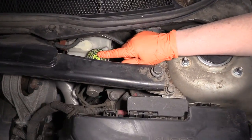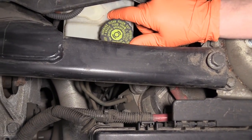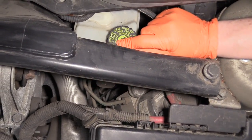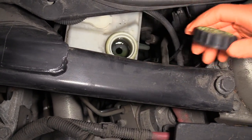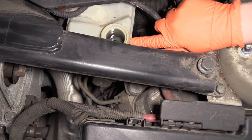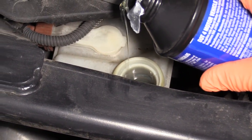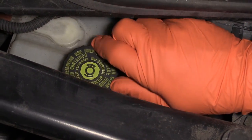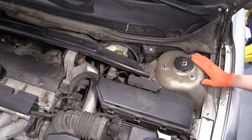After I've done the brakes, I'm going to check my reservoir and add brake fluid. The reservoir is located right here in front of the driver's seat in the engine compartment — the cap clearly says brake fluid and it tells you DOT 4 brake fluid; this is a European car. Take the cover off. I can see the markings on the side — there's a max and a min and I'm right at the minimum line. Now I'm just going to add some fluid and top it off. Now that the level's at the proper level, I'm going to reinstall my cap, pump my brakes, see how the pedal feels, and see if I need to do any additional brake bleeding.